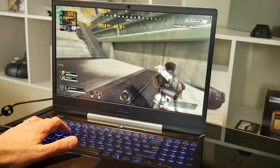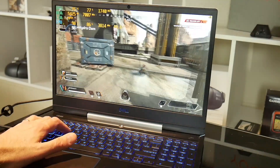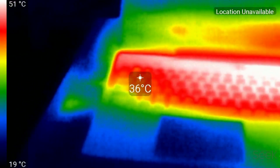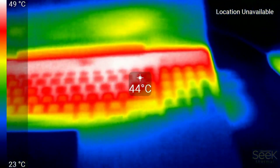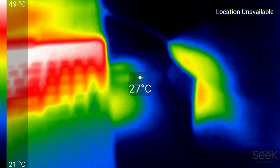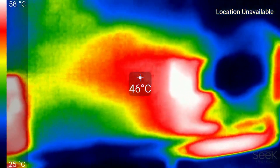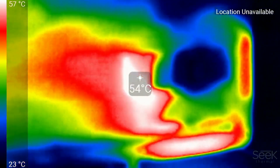It plays fine and I did enjoy using it, it's just that it does get rather hot — my CPU is running close to 100°C much of the time. Consequently the chassis also gets quite warm, especially since no cool air is brought in via the keyboard. The keys themselves also get quite warm, even the WASD keys are in the mid to high 30s. You do see warm air being pushed out of the 4 heatsinks but underneath it has a hot spot at about 54 degrees.